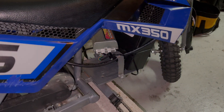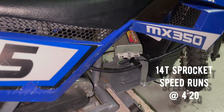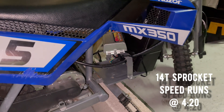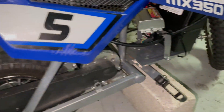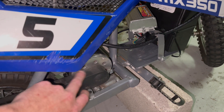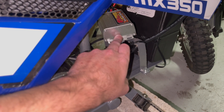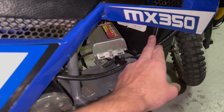So this is the final — well, the final before the last pieces, and I'll show you what the last piece is. It's got the lights, it's got the tail lights, it's got the upgraded motor — 36 volt, 800 watt motor — 48 volt 1000 watt Fast Scooters controller, and a 48 volt 15 AH BTR power battery.